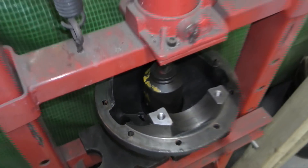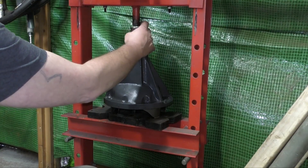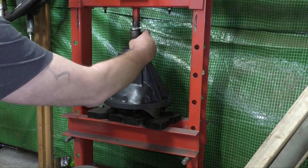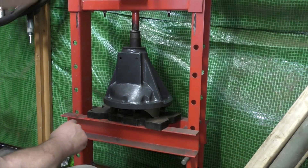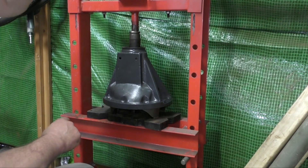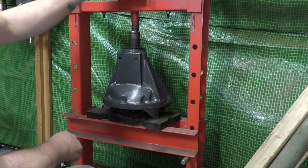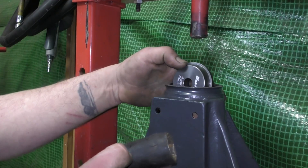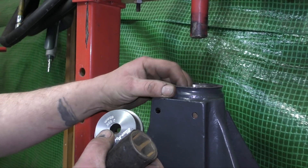That's quite easy — 10-ton press. Then what we have here is the other nose cone bearing, which is an easy fit with no shims underneath it. Once that one is in, it won't have to come out again, whereas we might have to take the other one out yet. You can see I've used this with a socket, and that's in nice and snug — we can forget about that one for now.